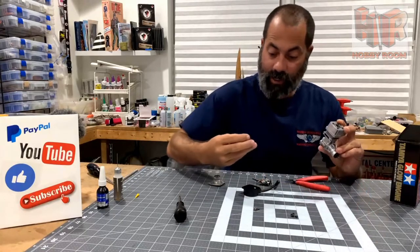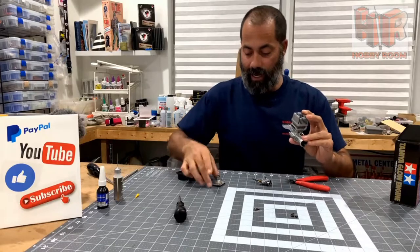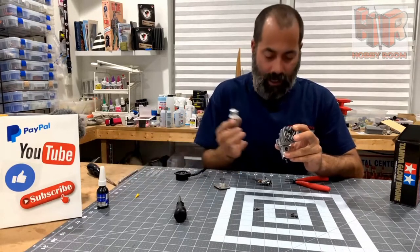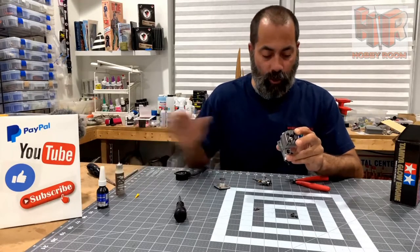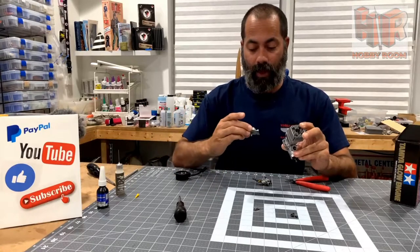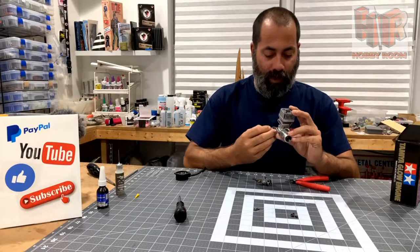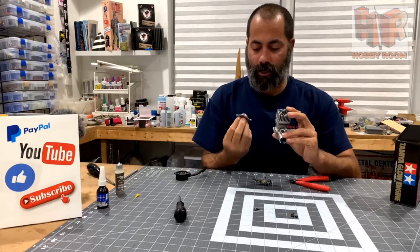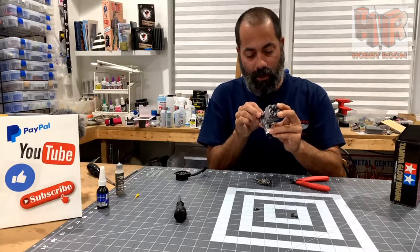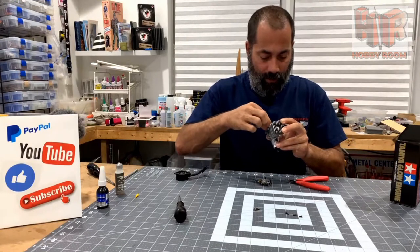Time for the back plate. This stands straight up and it looks as though this odd shape juts up into that corner. I generally take gaskets and use copper RTV on them, but this is a pristine original gasket and it's not exactly my place to do that. I'm going to index the crankshaft at bottom dead center, index this at bottom dead center, and lo and behold they key together very nicely — and it just worked itself right on up.